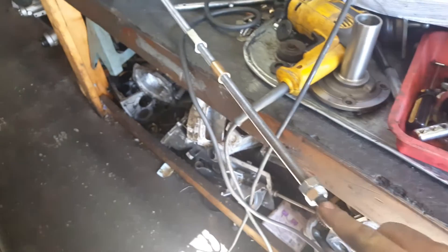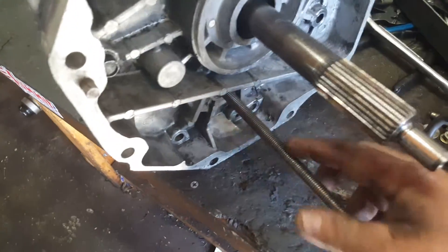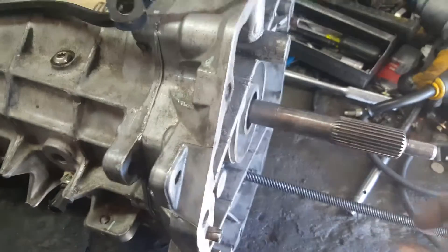All you've got to do now is put your dial indicator on the end of the rod. I'm going to have to cut it down — I'm not going to get any kind of accuracy this far out. Assuming that you have it cut down, you'll put that dial indicator on here just like that. Whatever you measure on your dial indicator, grab those shims from your pack, shim it up, measure it again. If you get no more end play, then you're going to go ahead and silicone RTV it all up.